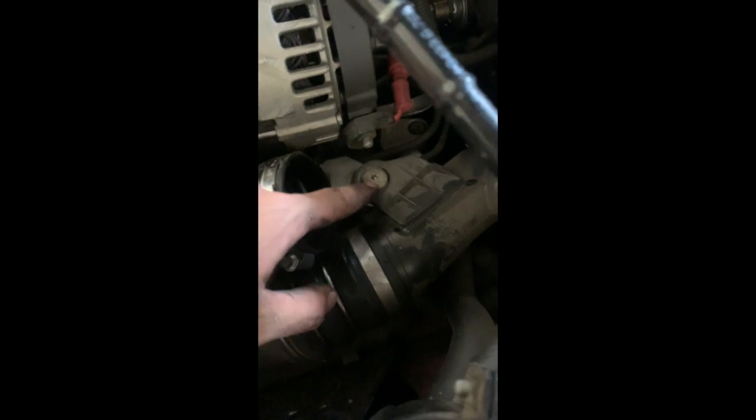There's a C-clip right here. You just put a flathead or the picks here and pull it out, and you'll need to remove this, probably with a T20, and you loosen this up so you can pull it out together with the charge pipe. And there's a T-map sensor here, so we should be able to unscrew it or unclip it. So yeah, I'll probably try to do that.